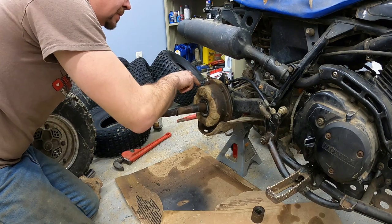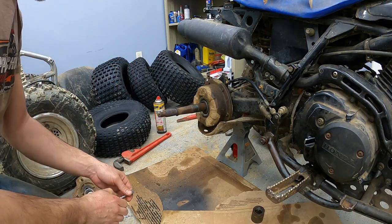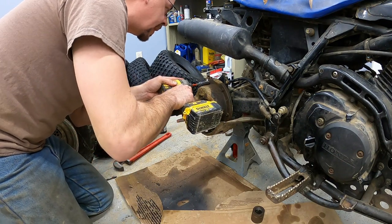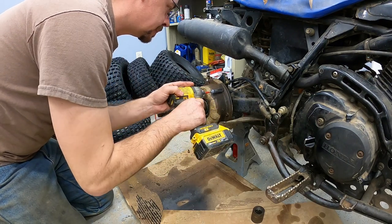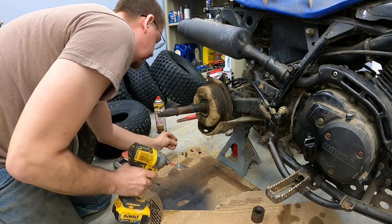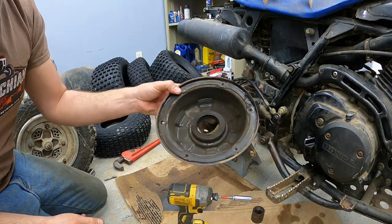This is just a pretty much a dust cover for a rear brake drum. Hopefully it'll unbolt alright and we won't strip anything - we'll be able to get right out. If not, then this is going to turn into a much bigger project. Fingers crossed - I hit these with PB Blast, hopefully they'll come out. They all do - we're golden. This guy slides off - look at that dust, we'll have to clean this guy up.